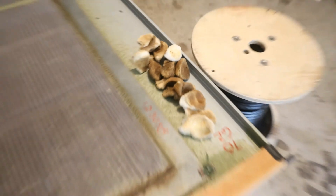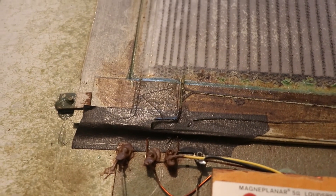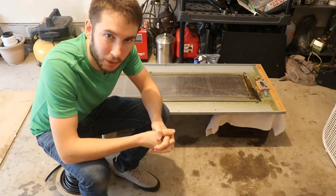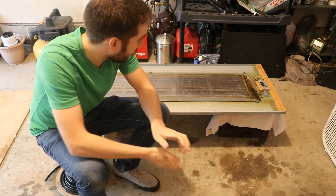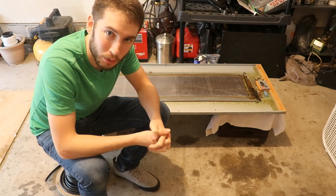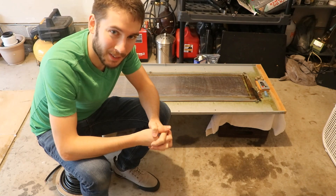As you can see, we have gotten this down to where it is clear and you can see directly through it to the magnets. We've got our pile of spent cotton balls — those will go directly in the trash. It's looking pretty clean. I have removed all of the old wires from this section. We'll be removing the solder terminals in the next video, but this is about as far as we need to get in terms of disassembly and cleaning for the full rebuild. Thank you so much for watching. We will continue this rebuild in part two, where the wires will get laid down, we'll use the right adhesives, re-solder the wires to the new solder terminals, add a new crossover capacitor, put everything back together, and maybe we'll even get a chance to test it. We'll see you next time.